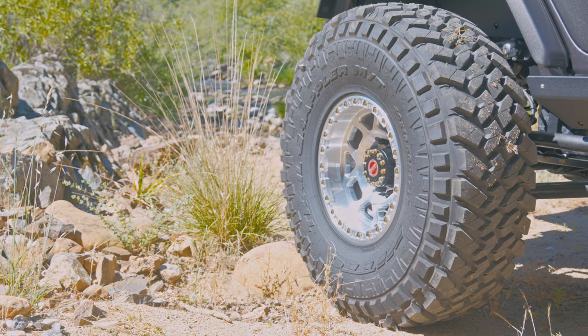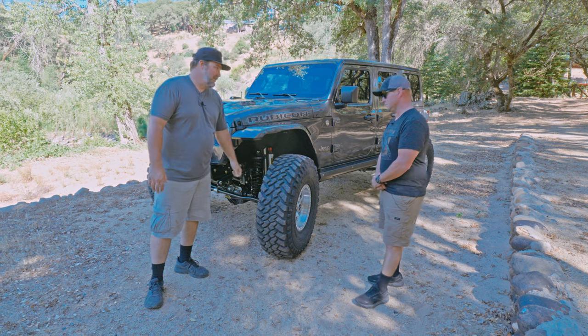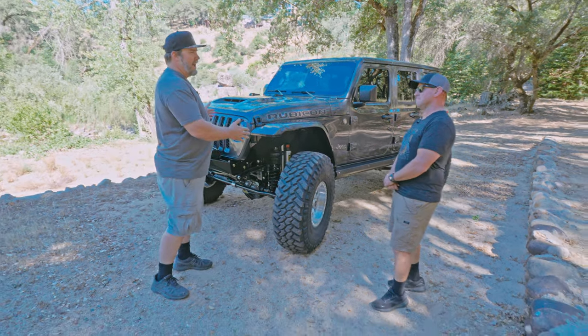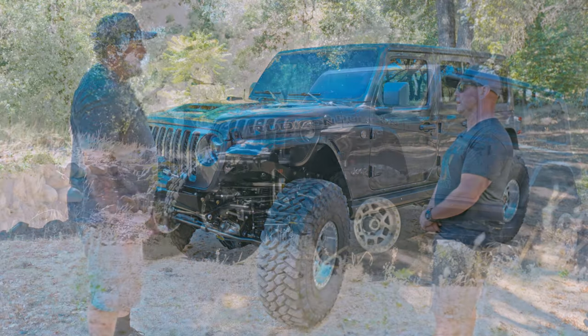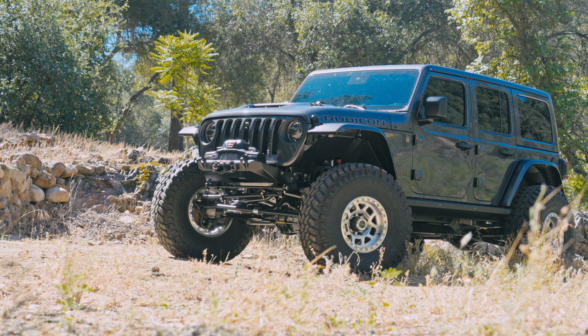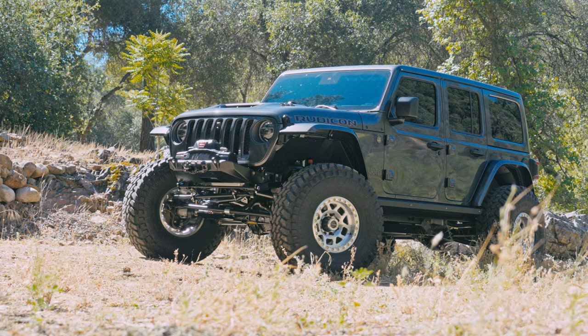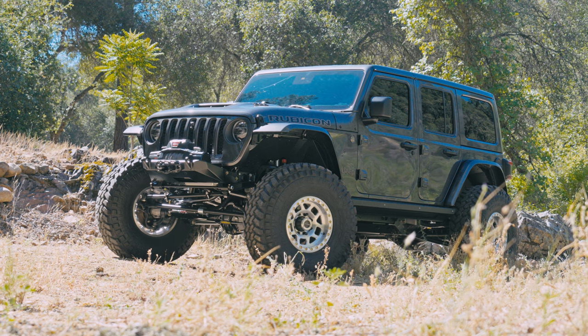They're forged Whiskey wheels. Oh, I didn't know they were forged. Yeah, and of course, it's the Whiskey wheel, if you know Ryan. What backspacing is on those? Because with the 72 and a half axles, if you did a 3.5-inch backspace, this thing would be just giant, right? Wide. It's a 4.5. So this has a pretty wide look to it. I'm looking, there's about two-thirds of the tire outside the stock fender. It gets a good stance, allows it to turn well, and clears the shocks.